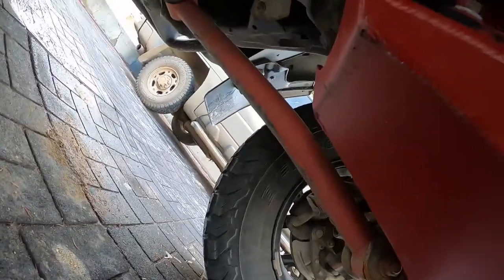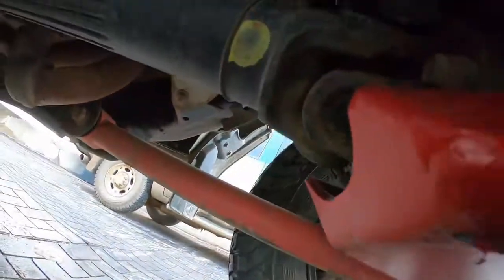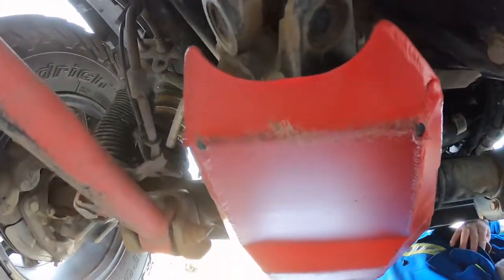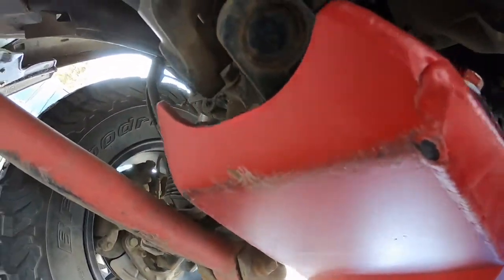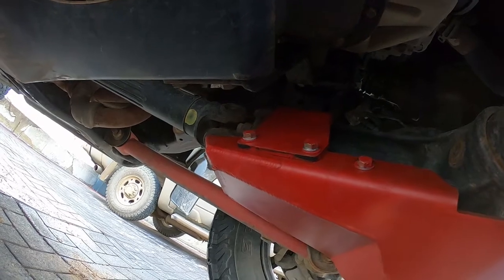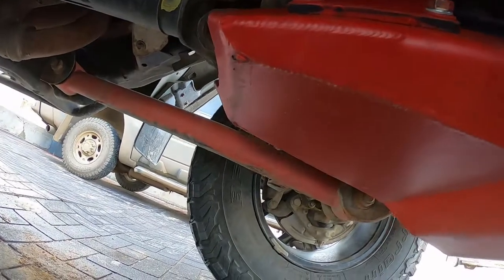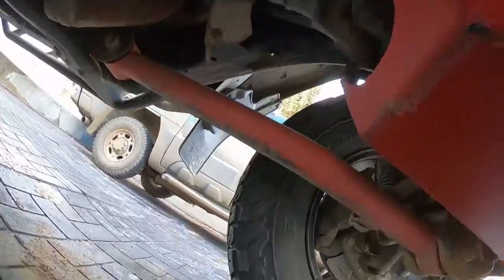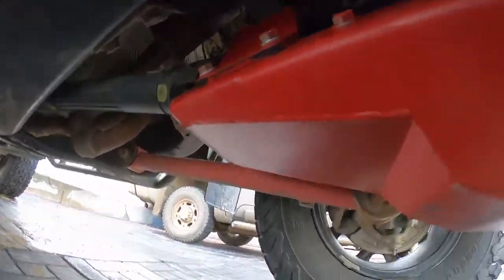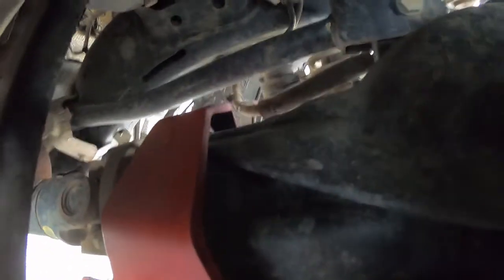I did the front the same way. I come back over the pinion, so your pinion's protected. And I got the Evo engine skid on here, so you've got to do some heavy duty sliding now to get hung up on that pinion. And then the drive shaft, rock between your lower control arms, engine skid, and these front axle skids now. And the wrap around.